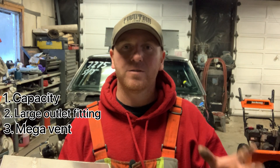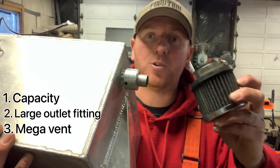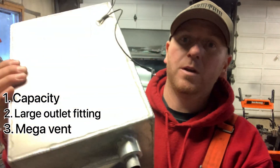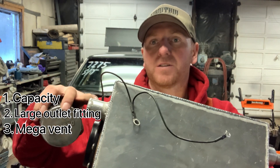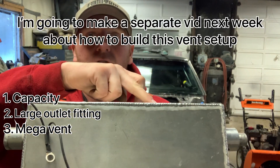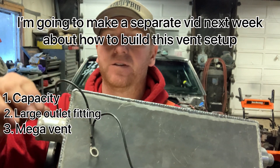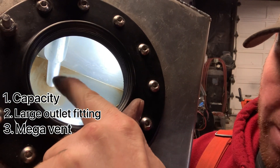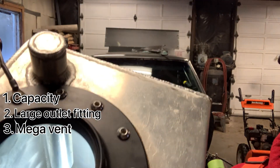It's a little weird to wrap your mind around, but basically this is my vent — it's on the bottom of the fuel cell. I've made this little bushing to put this filter on, but this is my vent tube. It's a three-quarter inch inside diameter aluminum tube and it goes all the way through the fuel cell to about a quarter inch from the top of this cap. This cap actually runs down to about halfway down the fuel cell. So basically the tube goes inside this other tube, and that makes kind of like a slosh baffle. You can see the sump right there, that's the vent tube coming out the bottom, and that other tube comes all the way up. It's kind of a weird concept to grasp until you see it, but it actually works really well.